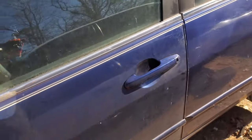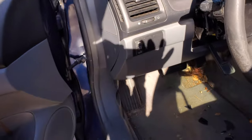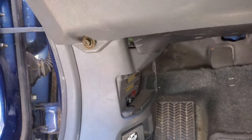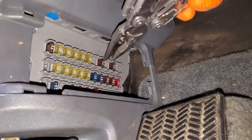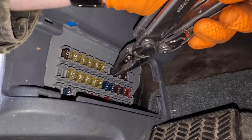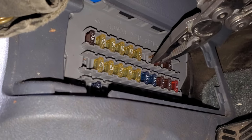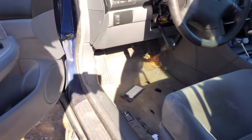Now, we've discussed how the relay receives the ground — but what actually sends the power to the relay? There's a fuse in here, a 7.5-amp fuse, and it's this one right here. That actually provides power to both of those relays constantly. The relays are activated not by the power, but by the ground.